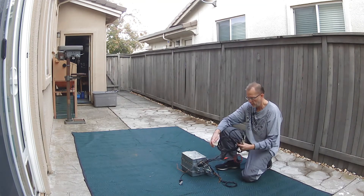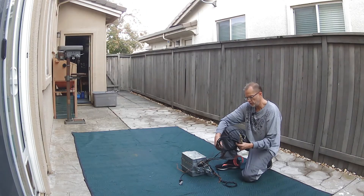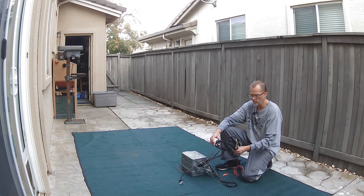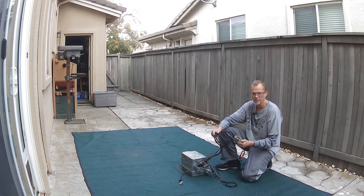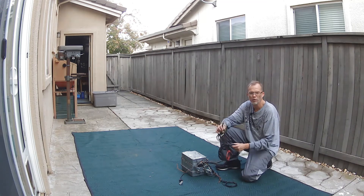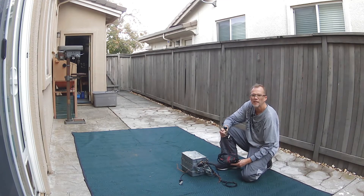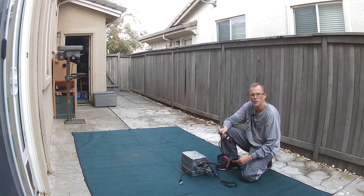These are the most important ones. The brown wires on here don't go anywhere — they sort of loop back on themselves and go to the inverter plug, and they act as grounds for the shielding in these cables. This is why I wanted to buy this harness, because I didn't think I could pull off making it from scratch. The yellow and brown wires here are for our Hall Effect BMW E46 throttle, but you can use any type of electronic Hall Effect throttle. This system will only use one of the two channels.